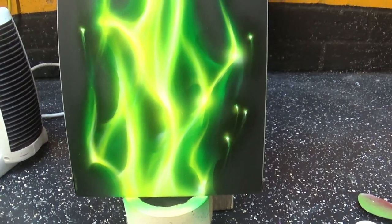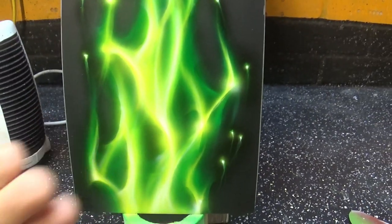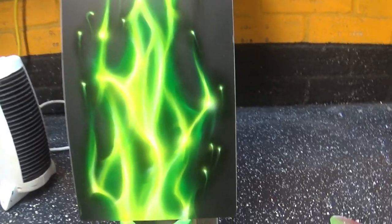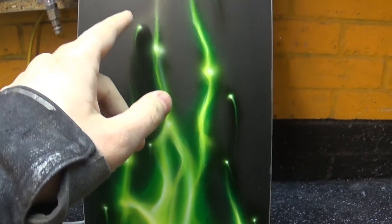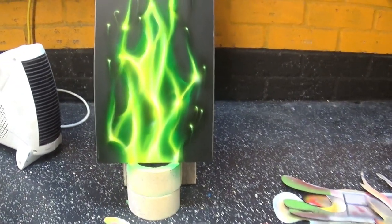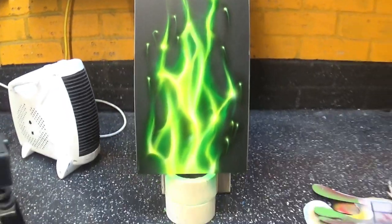We're nearly there guys — I'm going to leave it a little bit so that white becomes slightly less profound. It will bleed from the candy underneath, from the yellow candy, and blend in nicely. Just one more step — and that's pearl: indigo pearl. Just like with True Fire, I'm going to focus on the areas in the black, on the outline of that flame. The indigo pearl is going to give it a nice, very subtle change — when it's clear coated you won't see it until you look from a specific angle, and it will become visible again.